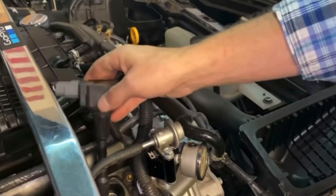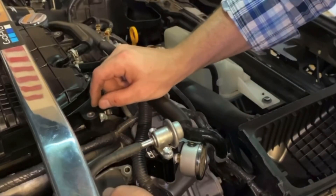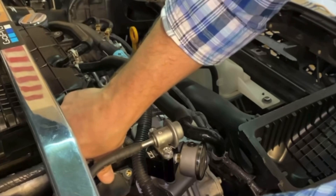Now, if you're planning on upgrading a bunch of things — throwing on a supercharger, adding nitrous — or if you just have a higher-mileage G37, Q50, or 370Z and you want to change out the spark plugs and get the car tuned, and you're already going to be in there, then swapping out the coil packs for these Z1 high-energy units makes perfect sense. You're potentially adding more fuel, more air, and making adjustments to the ignition system — timing adjustments through the tuning process. Going one step colder on plugs for forced induction, maybe two steps colder, paired with new coil packs — that's a good combination to help your car reach its fullest potential. Just have reasonable expectations.